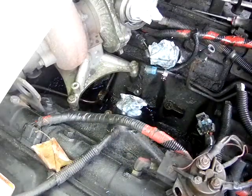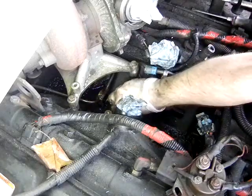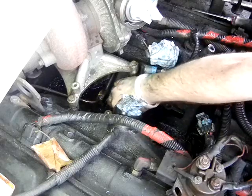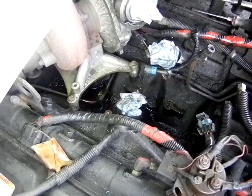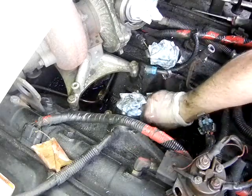And the fuel pump out of the way, you see we've got a gaping hole right there. And we don't want diesel fuel running down into our oil, so I'm gonna have to make sure to plug it right up. Do your best to not get any crud down in that hole. Take it straight to your engine, because you'll also need a 7/8 inch freeze plug to accommodate that hole there, because you'll need to close it off from now on, because there won't be a mechanical pump there any longer.